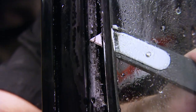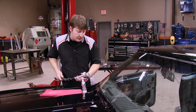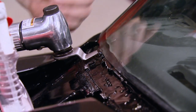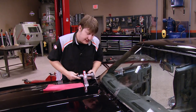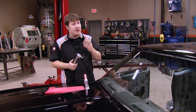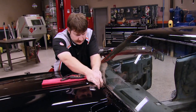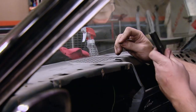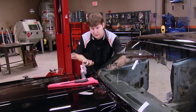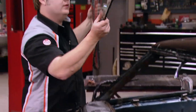The standard windshield knife is long and has a lot of leverage to it. The air knife is another option — you simply push it through the sealer and push the button, and it starts doing its job. But it requires a good feel, so using the more primitive style tools reduces the chance of screwing stuff up. For the piano wire type, make a hole for the wire, push the small piece through, feed it into your pull handle, and you're ready to start cutting. Be careful not to pull upward while sawing, because the edge of the wire will dig into the bottom of the glass, bust it, chip it, scratch it, or chew it up.